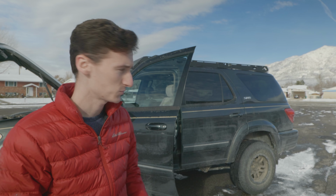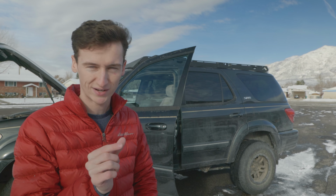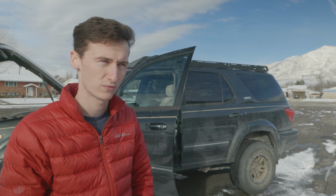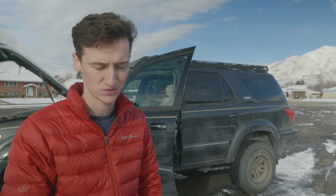I'm not going to demonstrate this in this video, but it's pretty easy to just pop off a tire, lift up the vehicle, take off a tire, and these little wheel speed sensors just have one little bolt holding them in, really easy to access and to change out. The price of getting one from Toyota is pretty expensive, but the aftermarket ones I've purchased to fix our traction control system have worked great, so I don't see a problem with buying those aftermarket.